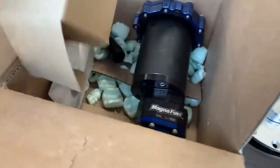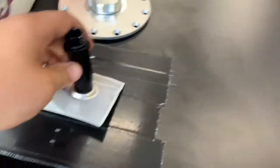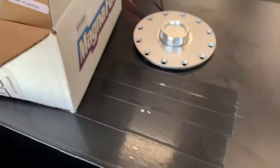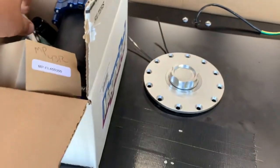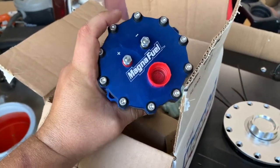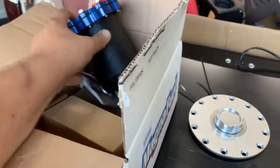It comes with the pump, and then there's a little piece that screws into the bottom of the pump. This just pushes in as a small intake filter — I'll run an inline filter later — and then it's going to an -8 AN fitting on top. I'm going to run a -10 hard line out of it.